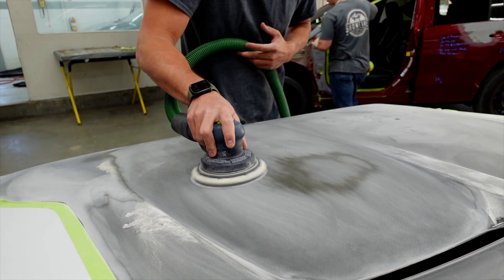When you're doing a two-tone and you want to draw a clean line like that, all of the color coats — you want to make sure they're as thin as possible. But the first coat you really just want to make a dust coat, because that's what's going to make the difference when you pull that tape off and you're trying to leave that clean line. If you come in close, you can see it's totally transparent — you can see right through it — but that's the base that when you peel that line off it's going to make it much cleaner.